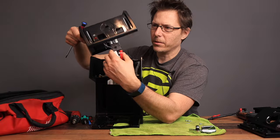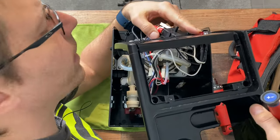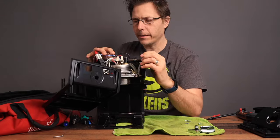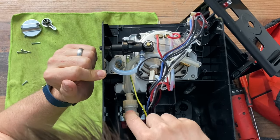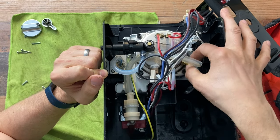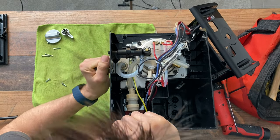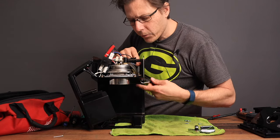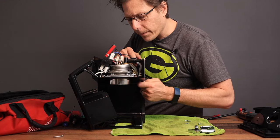With the casing off, you can see two indicator lights — the red one for heating and the white one for power. This is the overpressure valve, going up and around the top of the boiler, with the connection held on by a brass fitting and a metal clip. Here you can also see how the steam wand is attached — if you want to switch out the steam wand, all you have to do is remove these bolts to get the boiler out of the way, then access the ball joint where the steam wand is mounted.